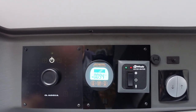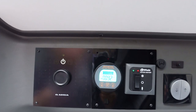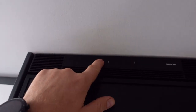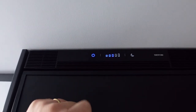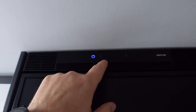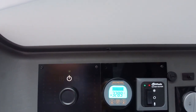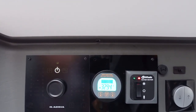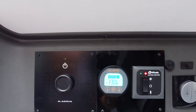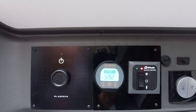Now the van isn't charging, I'm going to turn the fridge on at three-bar standard mode — not night mode. Over here you can see we're pulling roughly 3 amps out of the battery. It will switch on and off intermittently rather than continuously at 3 amps; obviously when temperature drops it turns off. But because the fridge is warm right now it's going to run for quite a while to drain the battery down for the test.